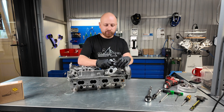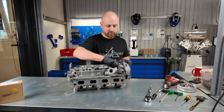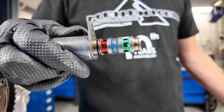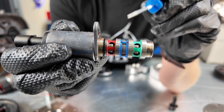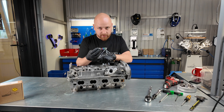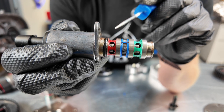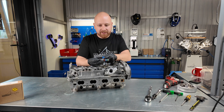Each phaser is equipped with its own control solenoid valve. Here we have the solenoid valve for the exhaust camshaft, and over here is the one for the intake camshaft. This solenoid valve is made up of several distinct sections, which I've clearly marked here in blue, red, and green for better clarity and understanding. The middle section, marked in blue, is the oil supply, which is essential for the valve's proper operation — oil comes directly from the oil pump. When the solenoid is turned off and the wheels remain in their default positions during startup, the oil is redirected from the blue section to the red section. So the wheels, right from the moment of startup and even during idle operation, are constantly and continuously supplied with oil without any interruptions.